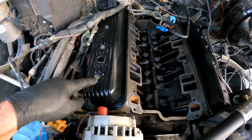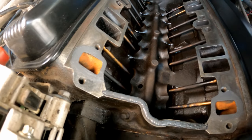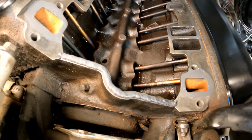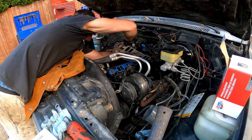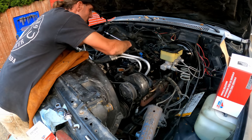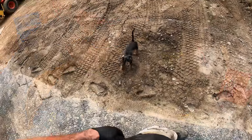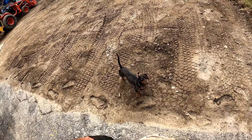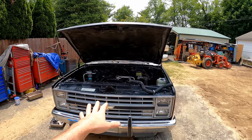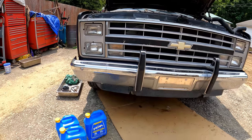These even have right stuff in between the copper gaskets so we won't have any leaks. That's what a smear looks like — just enough to fill in the tiny little corrosion crevices. And then on the block, it's like an eighth-inch bead or so. Next day, we're ready to fill her up. It's always a good idea to let the silicone cure overnight if you have the time, but you can torque and go — it's never an issue even if you don't have the time.